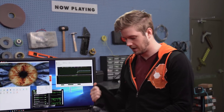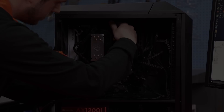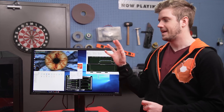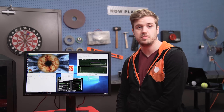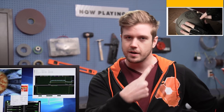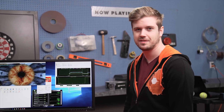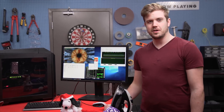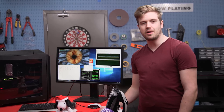I'm going to add maybe most of the remaining cables and see what happens. Side panels on, FurMark is set up, AIDA64 is already running — this test is a go. If this doesn't produce a result, there's probably not much more I can even do, and one conclusion from this video might be that if you have a standard mid-tower, cable management probably isn't that important. If you have something like a Node 202 or a really small case, it probably matters more since you'd be blocking all the air inputs — but on a big case there are enough open areas that air is probably going to flow. No change at all — CPU is at 50, graphics card is at 82. So it seems like if you have a mid-tower, you're probably fine in terms of cable management.